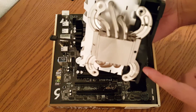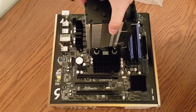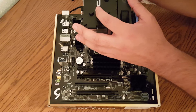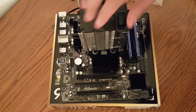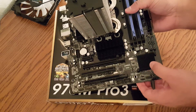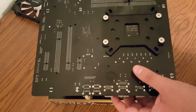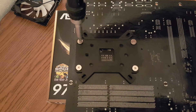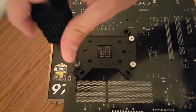From here you can see the installation brackets — they come pre-applied, which is really nice. Get those threads seated onto the mounting brackets, then use the black plastic standoffs to get the threads started. I removed the fan just to make installation a little easier. The easiest method to tighten down the cooler is to flip the motherboard over and screw the backplate screws on nice and snug — not extremely tight, but a good snug fit — going in a crisscross pattern so the thermal compound is distributed evenly for good thermal dissipation.